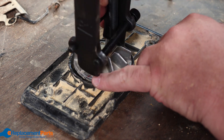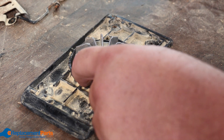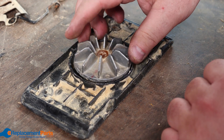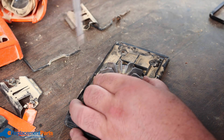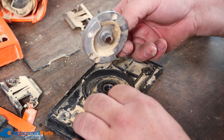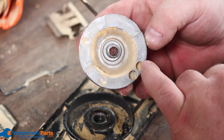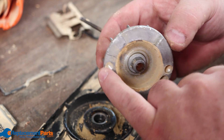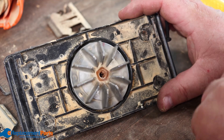That last part is just a press fit. Normally you'd come in with a bearing puller — it slides underneath and the shaft locks in to pull it out. In this case we don't have quite enough room, so we can either find a slimmer bearing puller or cut into the plastic a little bit. Since we're just doing a complete teardown, I'll come around with a screwdriver at each spot and apply a little bit of pressure just to loosen it up, then wiggle it right up and out. Looking closely at the shaft, you'll see holes — these are part of the balancing. As they spin it, they remove metal by drilling a little bit until they get the perfect balance, so we get the vibration effect while the weight keeps everything properly balanced and we're not getting excessive force up the shaft.